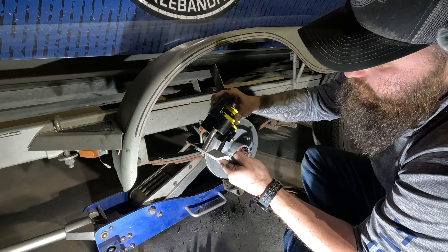We have a vacuum bleeder from Harbor Freight. A little hack I like to do is put a small zip tie over that hose on the bleeder screw — that just gives you a little extra insurance that it's not going to fall off on you while you're trying to get this done. We're going to hold our reservoir up above that bleeder because air goes to the top. We'll give it some squeezes so we start getting fluid, then get that bleeder tightened up. It's all the way tight and we're still drawing some bubbles, so we'll get this vacuum bleeder pulled out of the way.